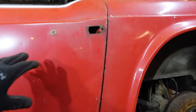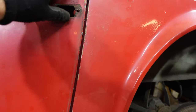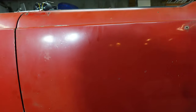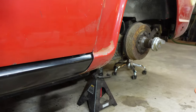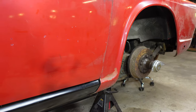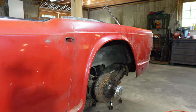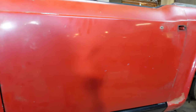Pretty much the same thing on this side — happy with how it fits. The door is a little bit low; if you can see that crease there, it doesn't quite line up — maybe an eighth of an inch or so — and the gap down here at the bottom gets a little bit wider. But when I manhandle the door a little bit and pick it up, I'm happy with that gap there, happy with the gap in the front. There's a slight bowing again, but I think some of that's just a slight difference in shape between the aftermarket sill and the original wing. Somebody had mentioned I have a lot of patience, and I had the Spitfire with fitment problems and gap problems. It's going to be a little bit easier with wings here that aren't solid to the car — I can move and adjust those.